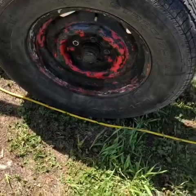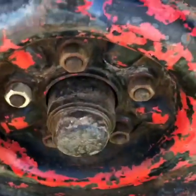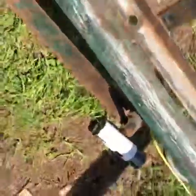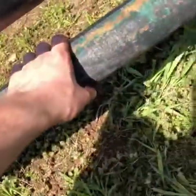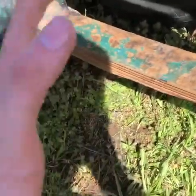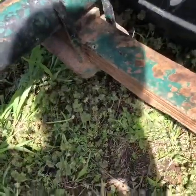I've been soaking my lug nuts every few hours with WD-40 to try and loosen them up before I take the wheels off. Then I'm going to take the leaf springs off and redo the bushings in the back, which I've already ordered. I used the wire wheel on the leaf springs and the axle rather than the grinder, because I didn't want to throw off the balance of the axle — that's going to cause the trailer to do the death wobble.